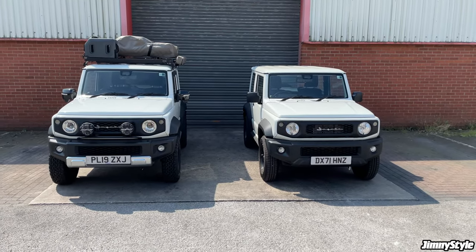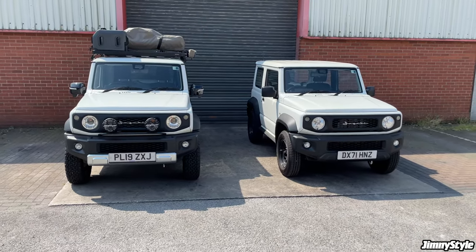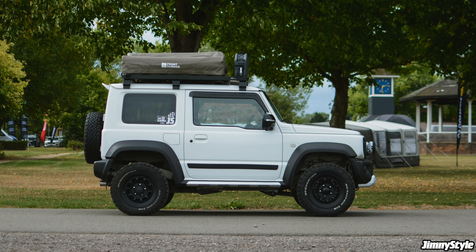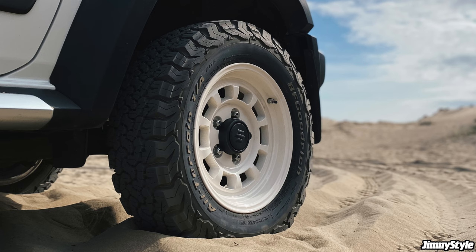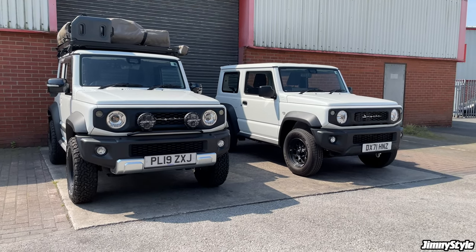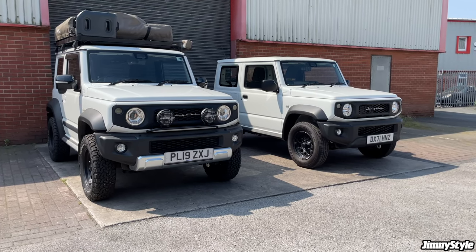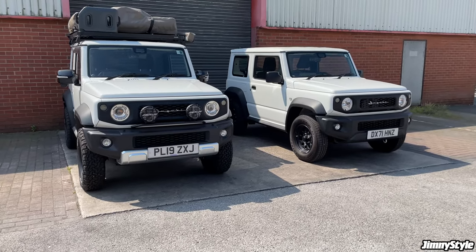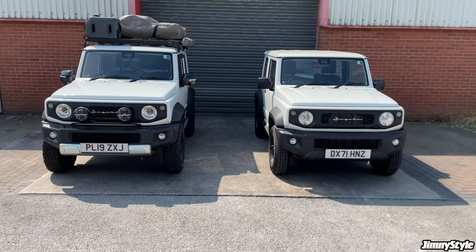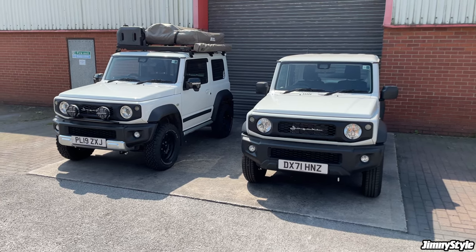Ignore the roof tent and the roof rack and the other various bits of overlanding equipment. The most distinctive differences are that the SZ5 Jimny on the left has been lifted 40mm and also has a set of 16 inch High Peak J01 wheels and a chunky set of BF Goodrich all-terrain K02 tyres. Wheels and tyres are one of the most straightforward, albeit not the cheapest, ways of making the Jimny look tougher and cooler — a really good chunky Tonka toy style look. We get a lot of questions about wheel sizes, tyre sizes, what will scrub, what modifications you need, so we'll go over some basics and show you a setup that will work straight out of the box.